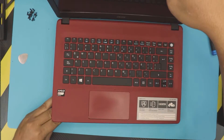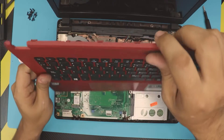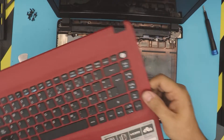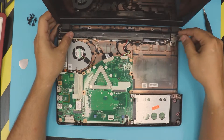Open up the laptop, wiggle it around, and you might hear some popping at the back — those are the clips at the back end. Right over here: one, two, three, four, five, six, seven. Once you remove those, down here you're going to see the battery right at the back end.